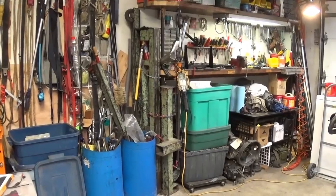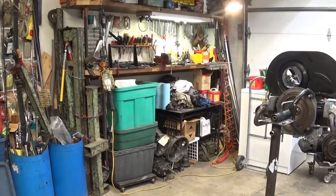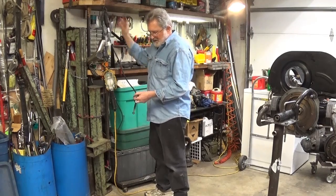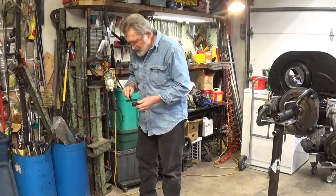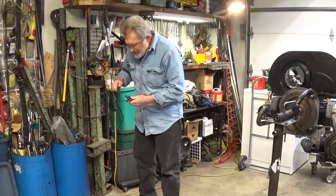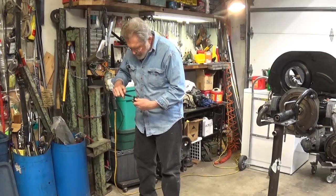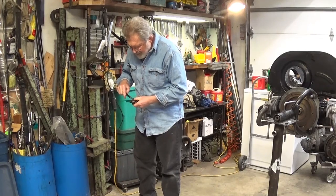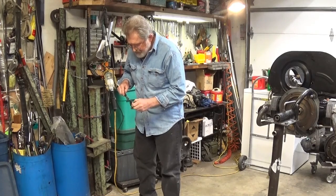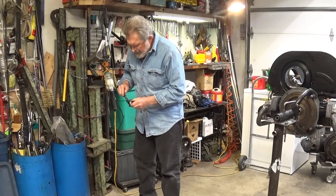Then I go over here to this side of the shop because I've got my Dremel tool there. I haven't cared much for Dremel tools, but I have used it a lot for these little fine jobs. And that little wire brush fits right inside the bore, because there's dried up stuff inside there, and there's spots I can't get to on that other wire wheel. And this just gets right in there. It just doesn't have enough power to do heavy duty stuff, but for this little fine detailed work, getting inside crevices, I've never used it this much before. I've had this thing for years, and I'm finding all kinds of little uses for it in this.